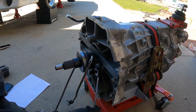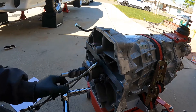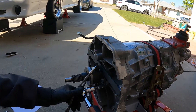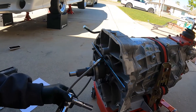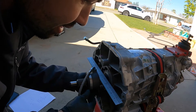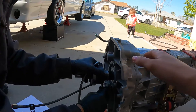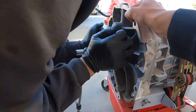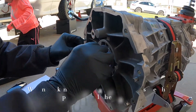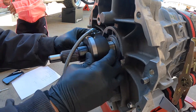This is actually a pretty easy install once you wrap your head around it. The adjustment is already where we want it, so let's slide this guy out. One thing I forgot to mention: the piston has to be all the way in when you take your measurement, because if it comes out that would give you a wrong measurement — it's got to be all the way in.